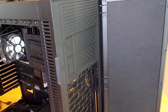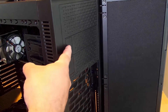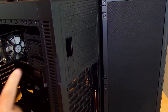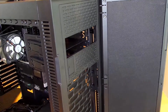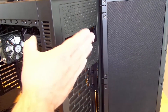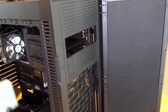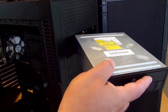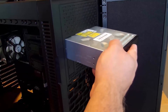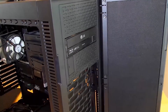I want to show you how these drive bays work out. You would just push this little button right up front and it's going to make a handle you can pull out, exposing the 5.25-inch drive bay. Now we're going to put in our optical drive — this is my Blu-ray burner — just slide it in, that's it.